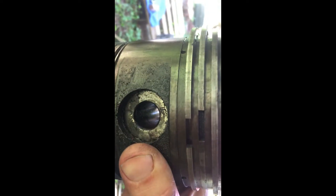To remove the piston, we've got a snap ring inside the wrist pin hole. You just pull that out and push the thing out, and the piston should just come right off. I'm sure there will be no complications. Got one out — let's see if it'll push. I'm going to work on that and see if I can get it out.